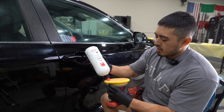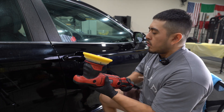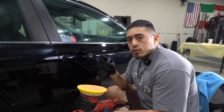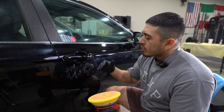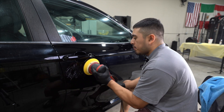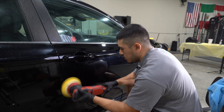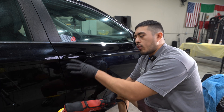I'm going to saturate the area a little bit. When it comes to polishing, you're not going to put as much down pressure because you've already removed the defects with the cutting phase. Right now we're just refining the micro swirls that were put in the paintwork from the cutting phase. With this one, you still apply some down pressure, just not as much. You don't have to move as slowly because we're just refining the previous step. Tap it, spread it, put it on speed two to spread, then go to four to work it in.